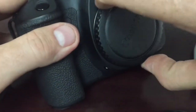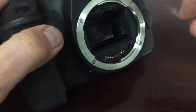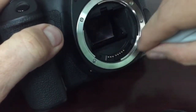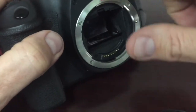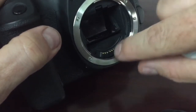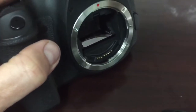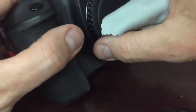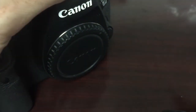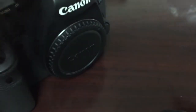Maintain your equipment. Prior to the sensor cleaning, you could have used a small Q-tip to clean around the contact points, because as you turn lenses in and out, there are very small pieces of metal and debris that get up inside of these ridges. Obviously, never touch the contacts themselves. I'll add one more thing: I can't tell you the number of lenses I've purchased on the cheap, especially where people thought they were getting over on me because they had a faulty lens — where just a number two pencil eraser to the contacts cured the problem.